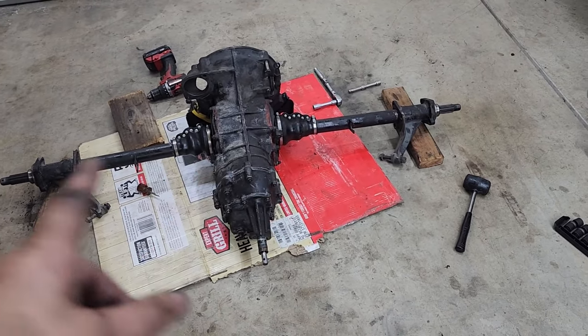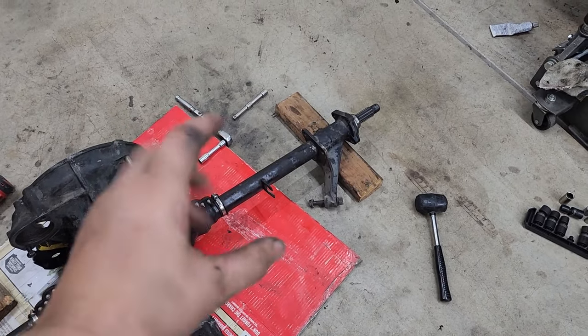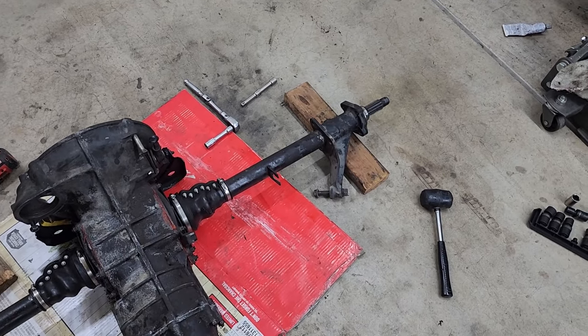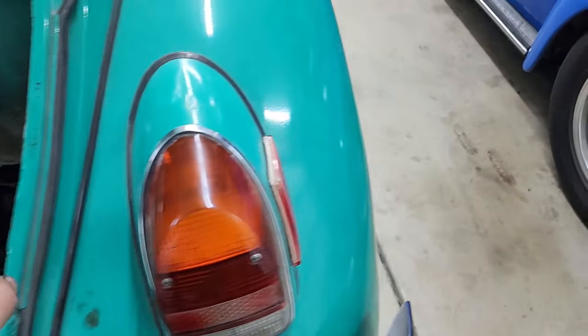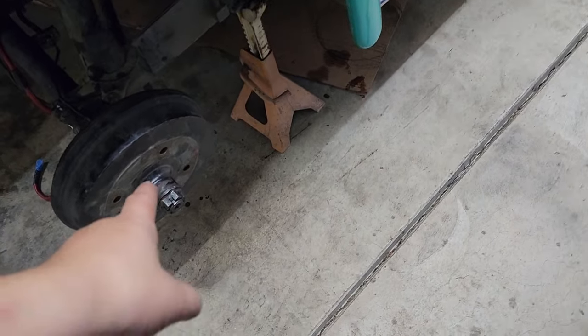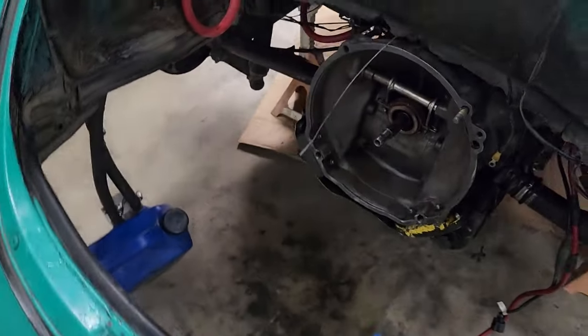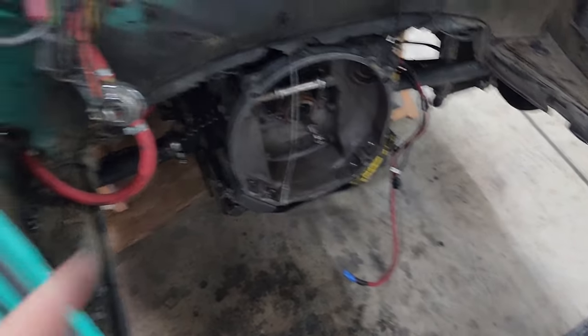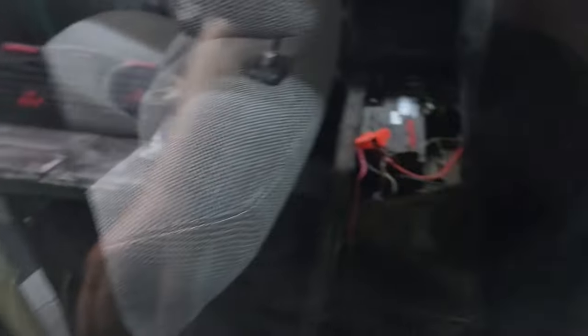Tubes are on. All those things are snug but not tight, because they're going to be twisting — I need them to be able to twist. It's going back on the car — finally it's in. Everything's been torqued, those nuts have been torqued, the brakes have been bled, everything's connected. The clutch cable is connected, those boots are nice and tight, and the connection to the linkage from there to the little square thing is all connected.